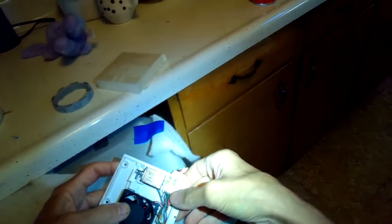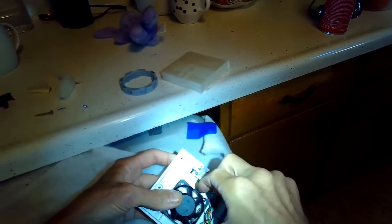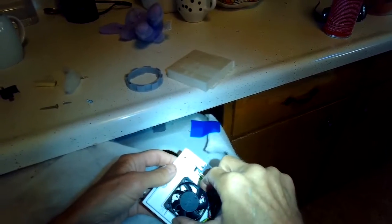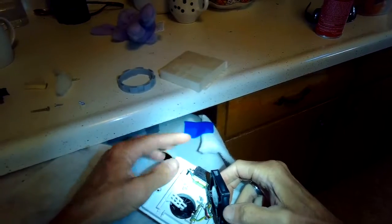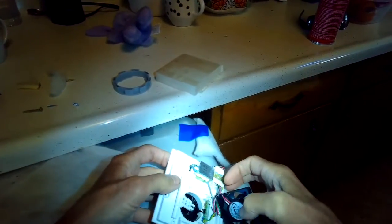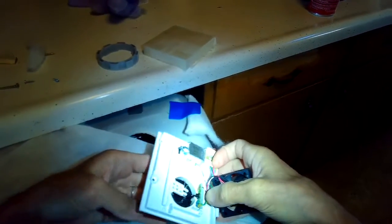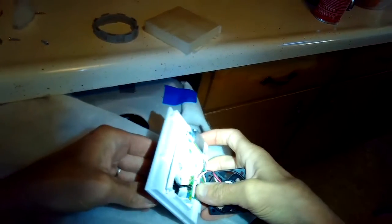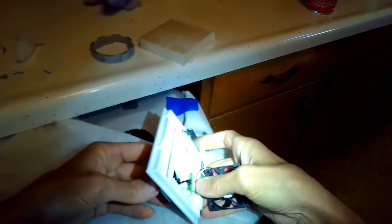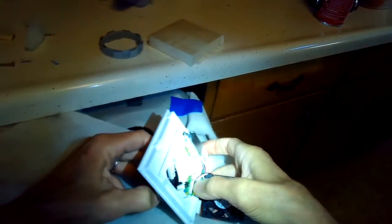And then we have a motor that moves a lever, and that lever allows the vent to move up and down. So this is the little fan. Here's the vent underneath the fan. And there's also a little circuit board, and the circuit board has a light sensor that sends LED light outward, and there's a collector on the other side of it. It's only a tiny little gap, probably 1/16 of an inch, in between the emitter and the collector.